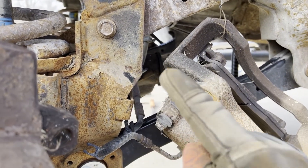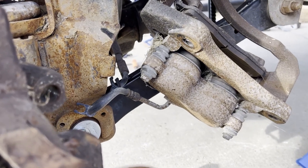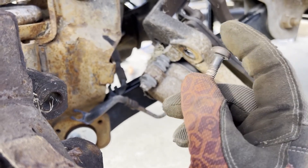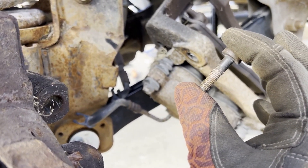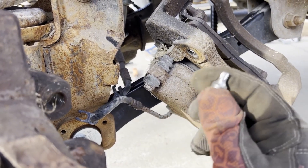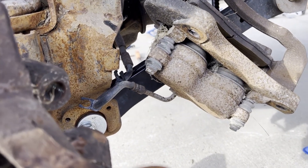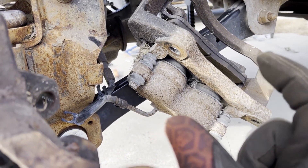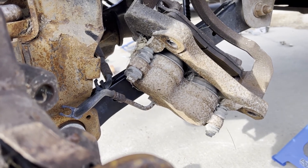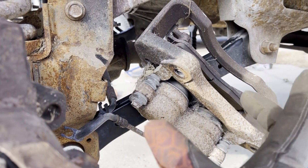That alignment controls the pitch to help with the drive shaft. Speaking of the drive shaft — you have four Torx head bolts, T40s. I was only able to get one out; all the others are stuck and I ended up breaking a bunch of bits trying to get them out. I'm going to run to town to see if I can find four- or six-inch long Torx bits to get them out, because I need to reuse that drive shaft — I got another one but it ended up being way too short.